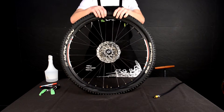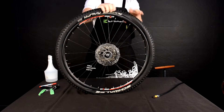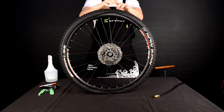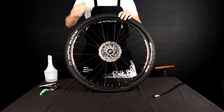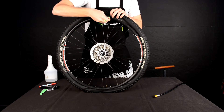With the tire flat, loosen the tire from the rim to ensure a simple tire removal. Next, take a tire lever and insert it between the rim and the tire, making sure to insert it opposite the valve.